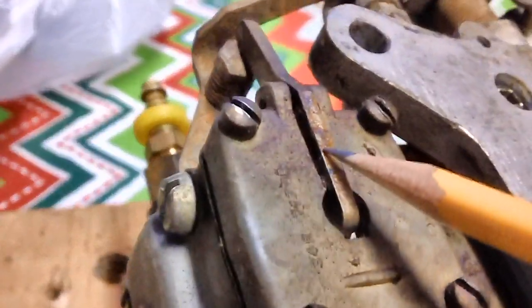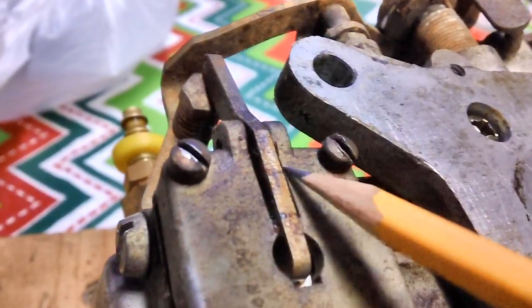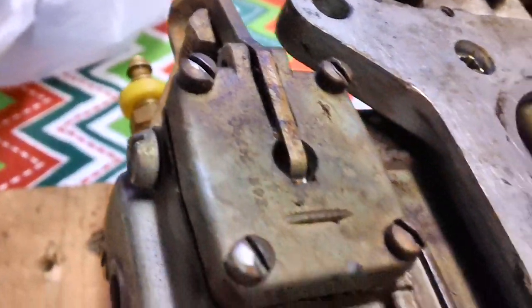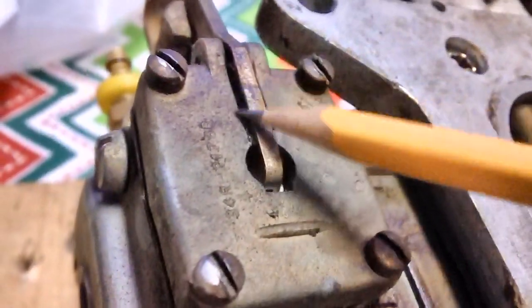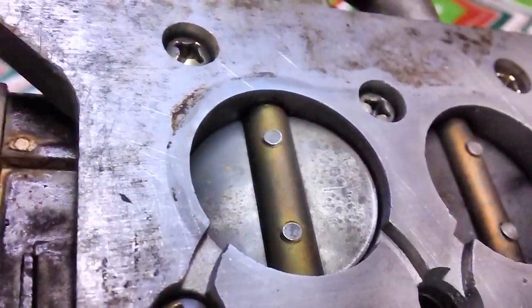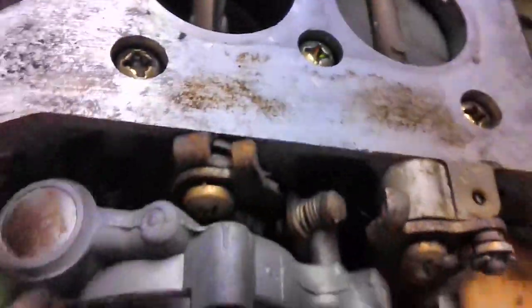Anyway, there again, look at the color. Look at the color you see right here. It's kind of a reddish, orange-reddish kind of color. That's lead from the old gasoline that we used to have. That's all lead. Look at the color of that screw. That's where there's been gas leakage and whatnot, and the lead would get out all over. Usually the Venturi are pretty much colored the same way, but I don't know.